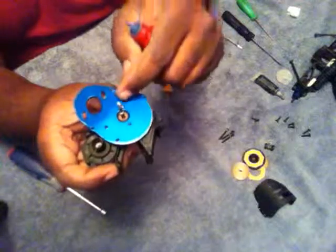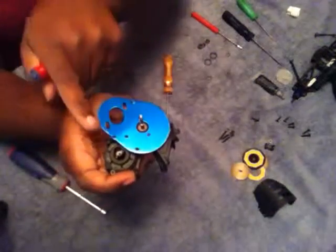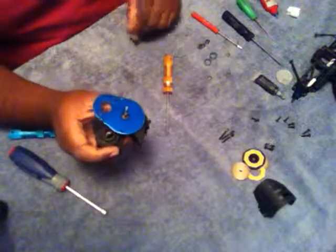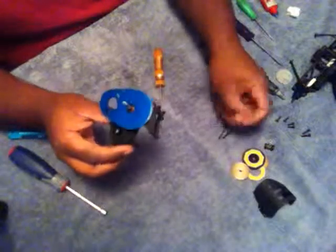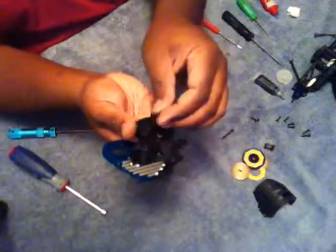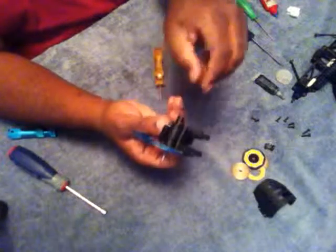And you'll see, now these 3 holes here are the other mounting holes. This external hole here that you see out there at the very edge, that's for your gear cover. We don't need any Loctite in there. So we're going to go ahead, we're going to put our last 3 bolts in the transmission here, and go ahead and tighten it up.